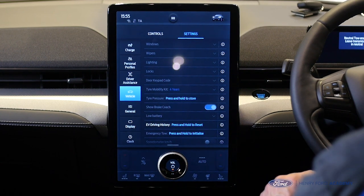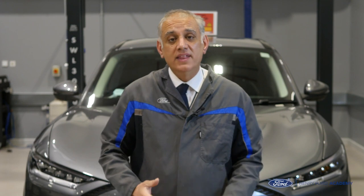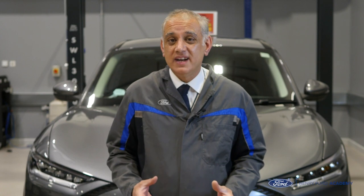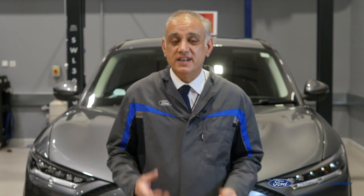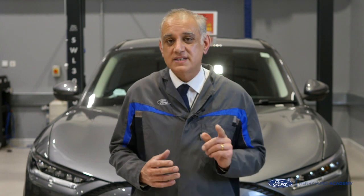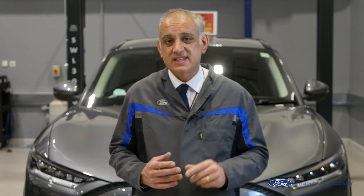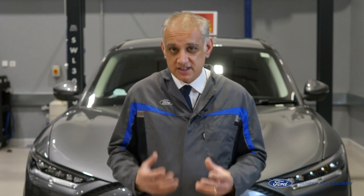It's something important to bear in mind — we must select emergency tow mode. We hope that our customers don't find themselves in that situation, but we know exactly what to do if we need to recover them. Please remember to keep that speed low, keep that distance short, always select neutral, and select emergency towing mode. I hope you found this video useful. Thank you for watching. See you again soon.